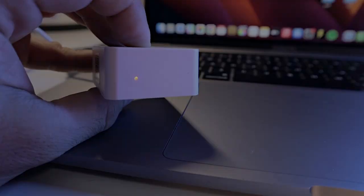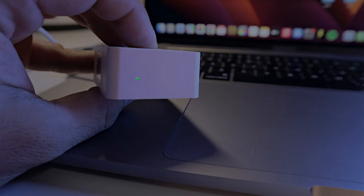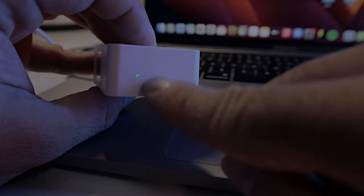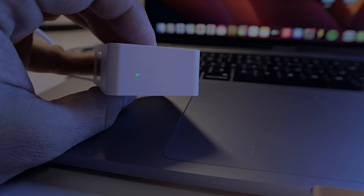Setting up the hub is very simple. Connect it and it will blink a light on the front. If it's not blinking, press it for about five seconds — the light will become orange, and after you release your finger it will start blinking between orange and green. If it says it's not connecting, just unplug it, wait ten seconds, and plug it in again.